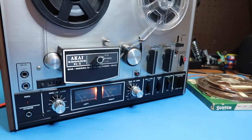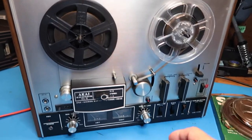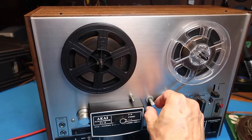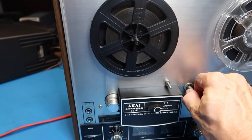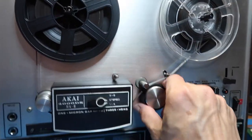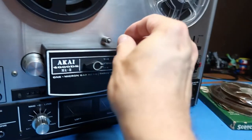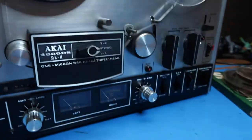I'm going to have to look up the manual on this. After reading it, it turns out the tape speed is determined by the capstan. They say to put a belt or pulley on the storage post. This looks like the storage post here. I'll read which part is the capstan — I thought it was this rubber part, but maybe not. Oh, here we go — it looks like we unscrew that part, move it here, and screw it back so we won't lose it. I just learned something, and maybe you did too.